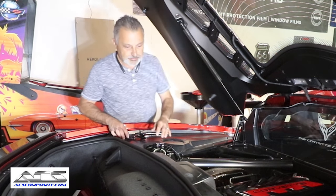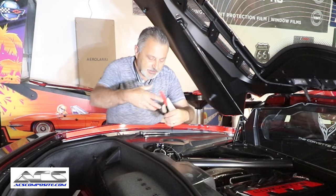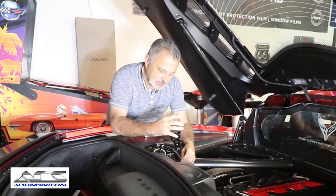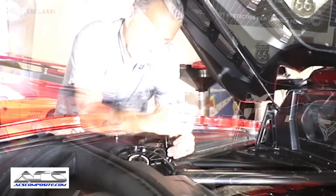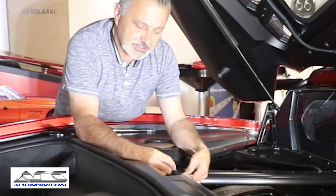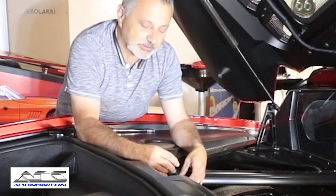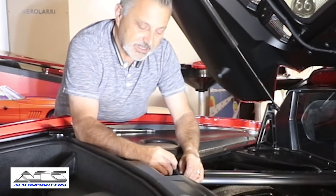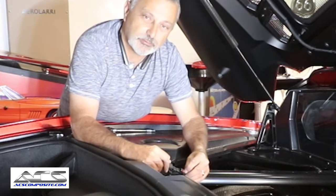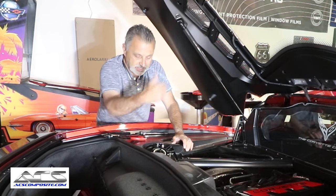We've got to get ourselves prepped. Because this one has MagRide, we've got to take our MagRide connector loose — there are little Christmas tree clips that hold them in. You can use a nylon pry tool or a specialized tool to keep stress off the plastic. Pull it out, and there's a red security tab right here that you're going to pull. Then there's a black tab behind the red — press down on it and it will come loose. We'll do that on the opposite side and then come back.